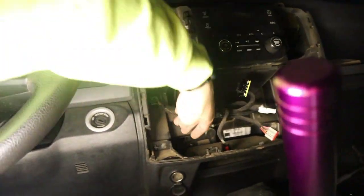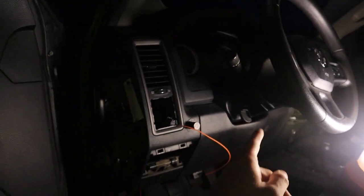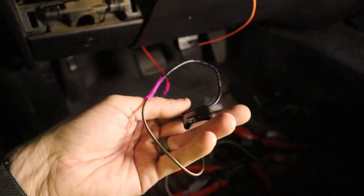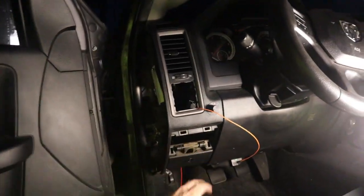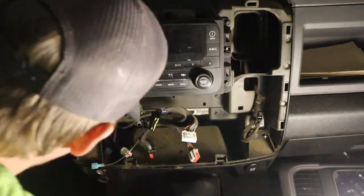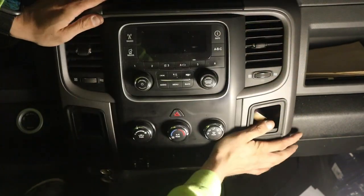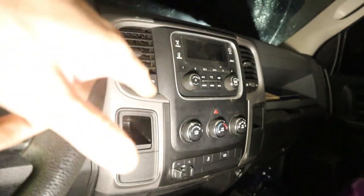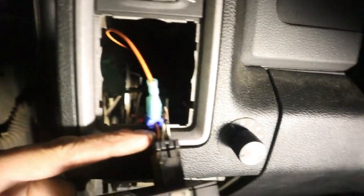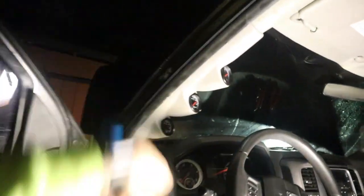I unhook the batteries, and before I did that I went ahead and tested the cigarette lighter harness. There are two wires — the blue wire will be my power on ignition, so I run my power to that. You have to run an inline fuse, which they provide, so I've got that right here — a one-amp fuse. I'll put it up underneath the dash so it's easy to access if needed. Just finished tapping the cigarette lighter and got the power sorted. I also tapped my dimmer wire, which is the orange wire with the blue stripe. I'll push everything back into place, put the covers back on, hook up the batteries, and then we'll make sure everything works.